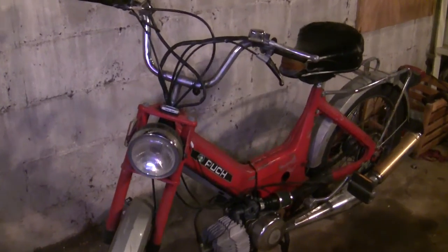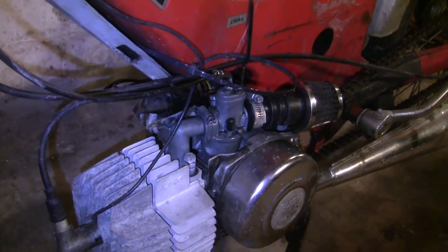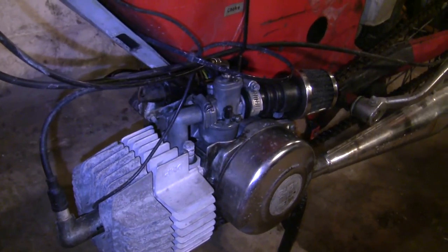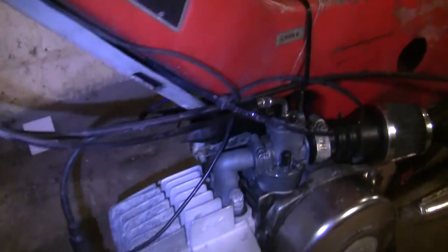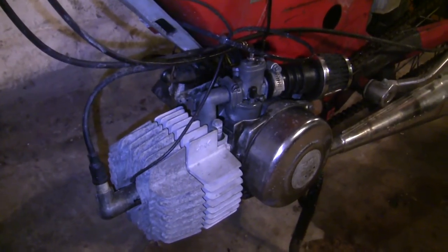I started doing all my research when I was tuning the DMP kit on this 1977 Maxi right here, and I'm using a 14 Bing for it. One of the things I learned is that you're going to have to work harder if you've got a piston port kit like this one. If you're using a kit with reeds, it can be a little bit easier — you can kind of get away with having a little bit too rich idle. But I don't, so we have to work a little harder.